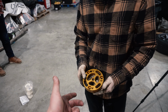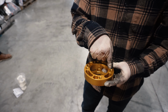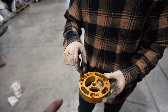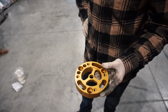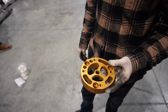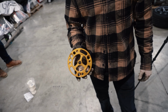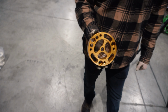And we have this for every different BMW transmission there is. So what is this exactly? This is the BMW ZF, right? Larger diameter to a 1320 or 1350 U-joint. So this is the BMW ZF, I believe it's 94 mil pattern, maybe 86 mil, to 1350 Spicer. And we have them in the 105 mil, the 110 mil, 14 and 12 mil. So any BMW transmission, we have the adapter.